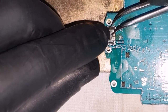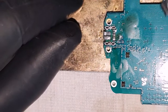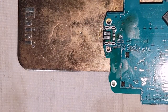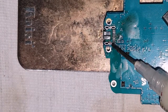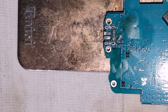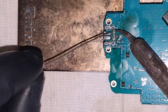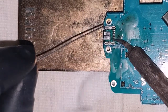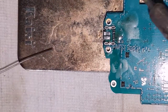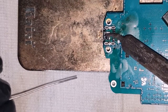Let's position this and replace the charging port. I'll start by aligning it on the motherboard, then apply a bit of flux on the pads first to get them all tinned up and ready to go. I use a little bit of flux around these joints to ensure an even flow of solder. Let's bring the solder and soldering iron and solder these joints up — that looks good.